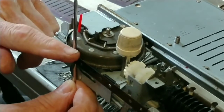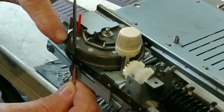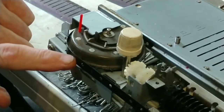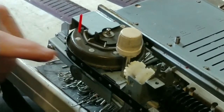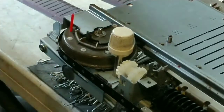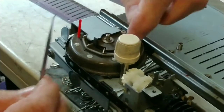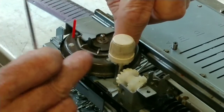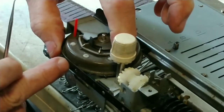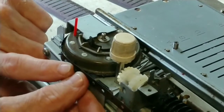So this is our relationship. The first notch in the rim after the timing mark is where that oblong hole goes. What they tell you in the manual is match the oblong hole to the notch in the rim. But you've got to have this relationship — that we came from the timed position between the cog and the cam rod around to where that notch is at 12 o'clock — and then we put our belt on here.